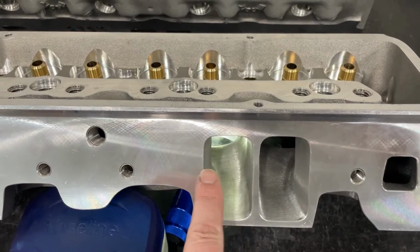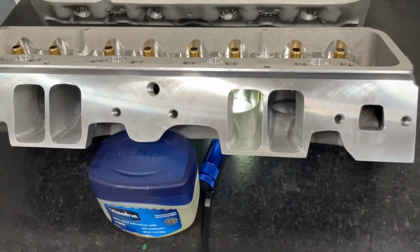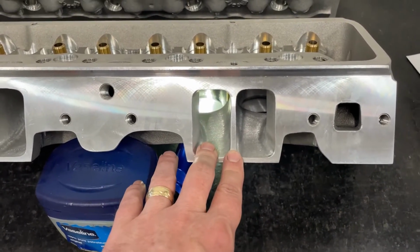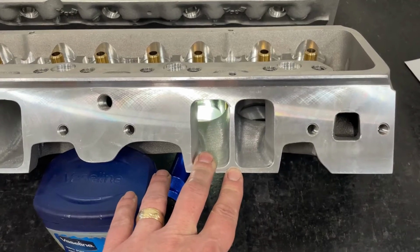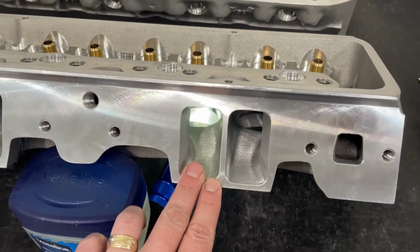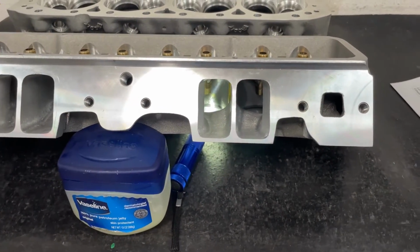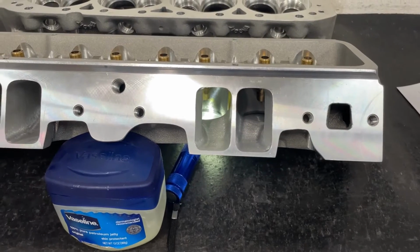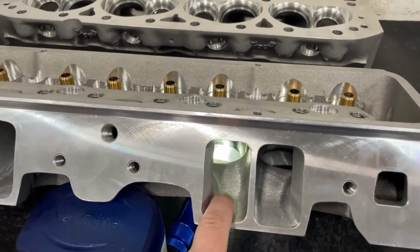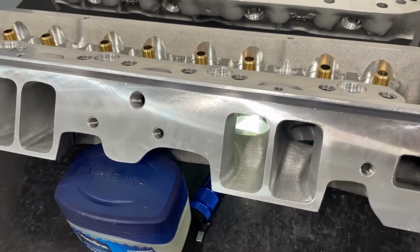But I used to have more material so I could move this over more and have a bigger area at the push rod pinch. Now I use Wallace Racing Calculator for the minimum cross-sectional area. And this one, if you're just using that, the 2.65 will peak about 7,000 RPM on a 400 and about 6,800 on a 434, around that in the ballpark figures. I didn't measure velocities, and I know everybody wants to ask that. I rarely actually measure velocities. I do so much of these, as long as I know what the area is when I'm porting, I kind of have an idea what's going to happen. But I will say the velocities are pretty fast through these anyway, because there's so much area here and amount of air that's moving. And I'll show you that in a minute.